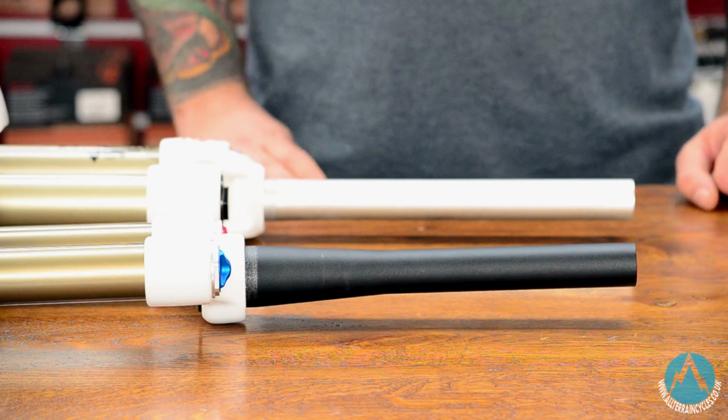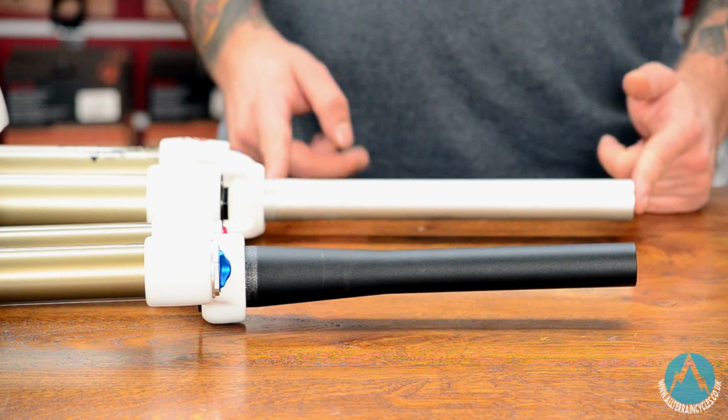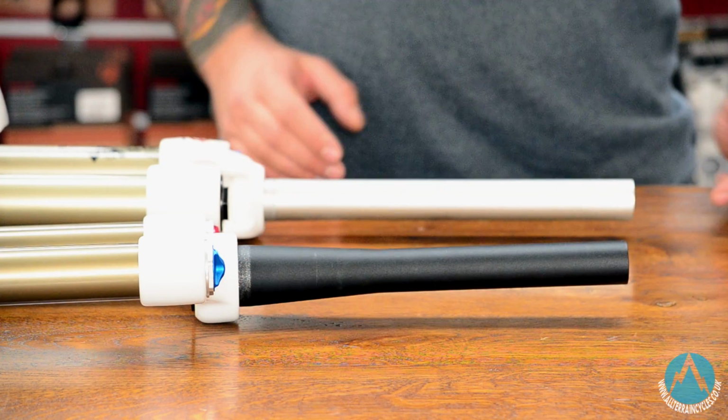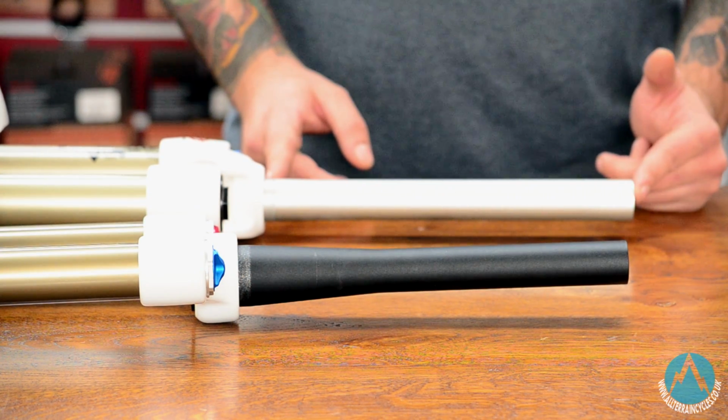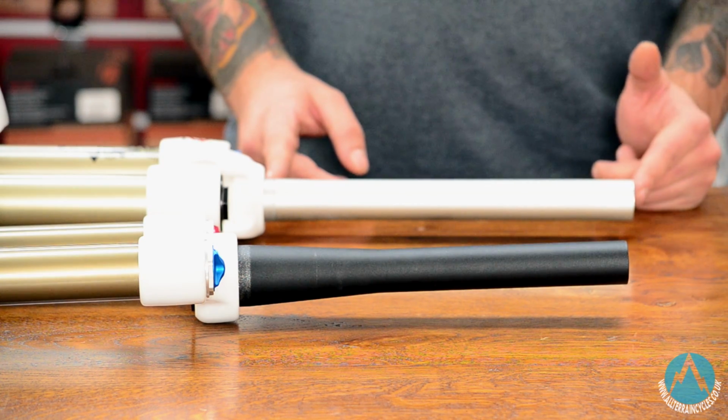Now we'll talk about steerer tubes. In front of me are the two most widely used designs. At the back, you've got the 1 1/8, and then up front, you've got a 1.5 to 1 1/8 tapered. The 1 1/8 has always been the most popular size up until about 2 years ago. These fit standard headsets, standard stems.